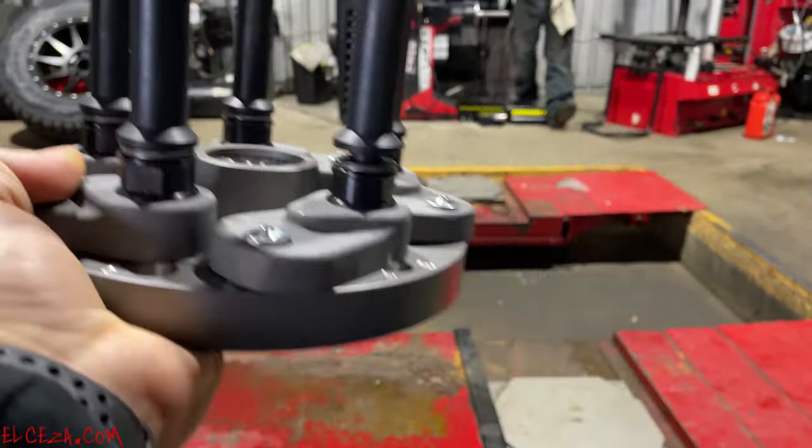Next step at this point is, I'm going to turn RoadForce off on this one. Lower the hood and don't touch the balancer. When calibrating the balancer, does everybody know how to calibrate it? Somebody shake your head no, please. Thank you. I will show you how, okay? When calibrating it, there's a little message that comes up that says, do not touch balancer. It isn't kidding. You can literally stand here and lean on it, and your heartbeat will be picked up by the balancer, and it will start over the calibration process. It'll do it over and over and over because you're leaning on the balancer. It says, don't touch it.